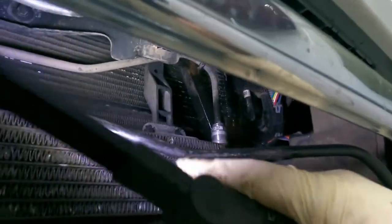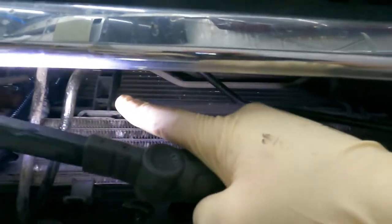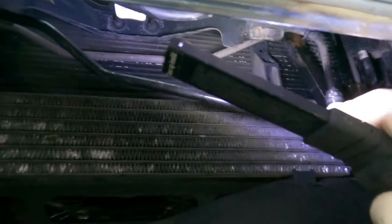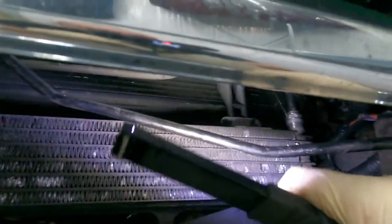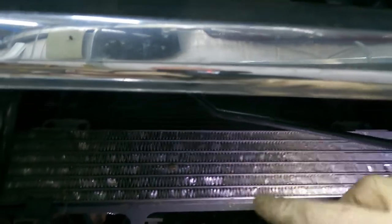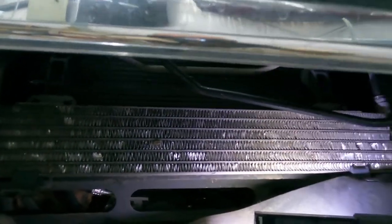Now both clips are out. I'm going to work on this one first since I have the new line right here. All I'm going to do is grab a pair of pliers and pull it up, pop that one out — it's cut just underneath this straight section. As soon as that one's out of the way, this new black one will pop right up into place and drop down. The nice thing about this GMC is the lines come in the top of the cooler, so we're not going to drain the whole cooler — we're only going to lose the fluid in the line. The Chevys have an up-and-down version where the cooler sits on top, so as soon as you pull the line everything comes out.